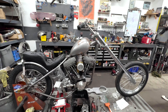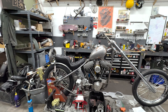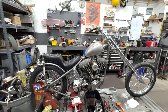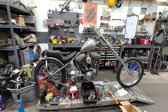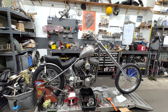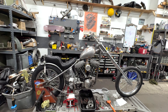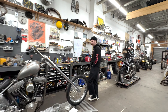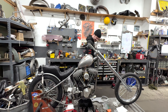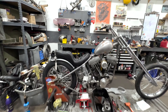So here's part one. I have to move the oil tank mount in the front, fix the sissy bar, and we need to order a few more things — like a gasket for the cam cover. Then we can start timing the mag, putting the whole primary together, and do the oil lines. After that, finish up the gas tank and then we can try to start it. Also need to add a battery eliminator to the list — we're just going to put a little one in the oil tank.